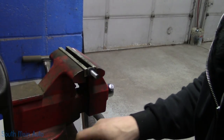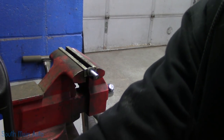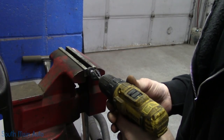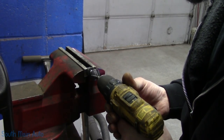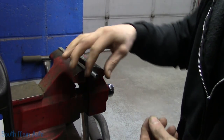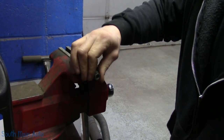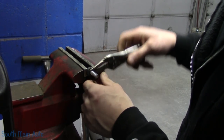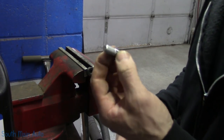There's the cutoff piece. I got out the Unibur — it's a tool for deburring, sent to me by a viewer all the way from downtown Hawaii. It's a cutter — we stick it on here and finish off the edge. Slow and steady wins the race for this little fella. It might be a tad warm still, but that should get rid of the burr. And then our nut should spin right on ever so nicely — which it does. Do that four more times and we will have the studs that we need.